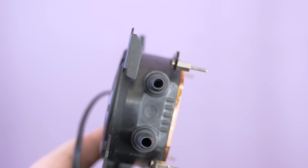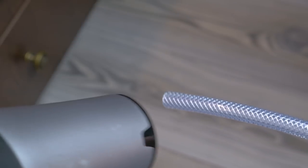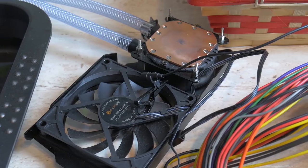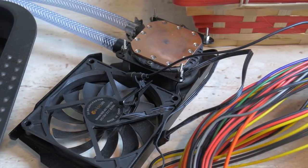So next step is to attach both tubes to your pump. A very good trick to get the tubes onto these fragile plastic barbs, which is normally very hard, is to keep the pump in your refrigerator for 30 minutes and use a hair dryer on the tube end before you slide it onto the barb. The barb contracts and the tube expands, allowing for a very easy connection without much force. This is much safer on these plastic barbs. Somewhere along the way I thought it was a good idea to also use a metal hose clamp on the repair barb, and when I tightened it — and I didn't over-tighten it — that's when I heard a pop. This particular epoxy is brittle when cured, so just remember that it's either of these two options, not both at the same time, unless you find some epoxy that is not brittle when cured. As a final solution, instead of re-repairing the barb, I just used it as is with a metal clamp.